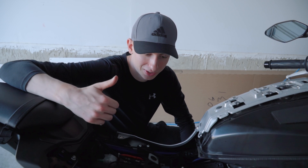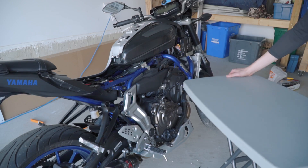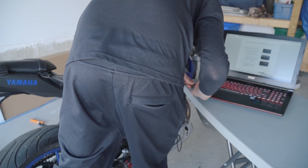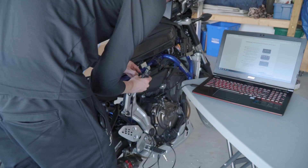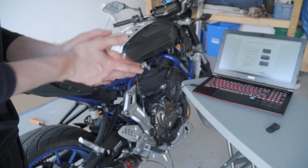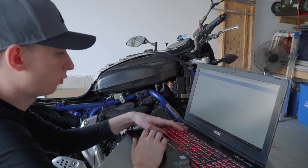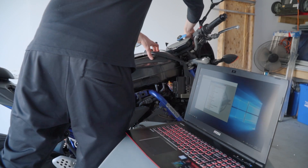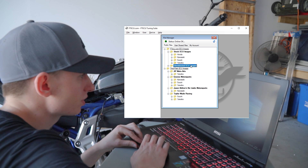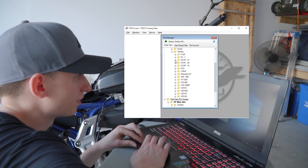Now finally the hardest part is done. All we have to do is plug in our computer, load up the software, and tune the bike. Take this USB cable, plug it into your computer, and now connect this connector into this connector. Pull this cap off — thank god, I thought they gave me the wrong connector. It's time to start. Make sure you have enough battery in your computer, open up the software, and put the key in. Don't turn it on yet. Go into unrestricted ECU images for Yamaha, then Yamaha FZ MT07, 2015 to 2017.